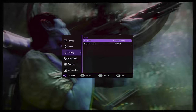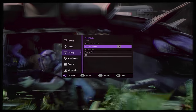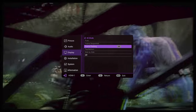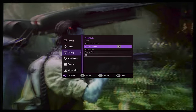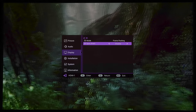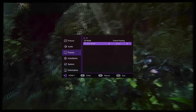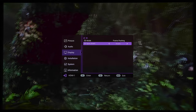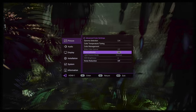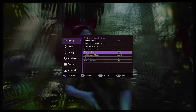If you are a fan of 3D movies, this projector does support 3D. You've got a few different options depending on what you're feeding into the projector: auto, frame sequential, frame packing, top-bottom, side-by-side, or you can turn 3D off. If the 3D image is reversed you can go under 3D sync invert and turn it on to invert, which should get it back to normal. While watching 3D material the light source mode is automatically set to normal for the brightest output.